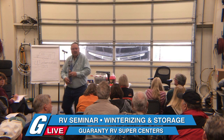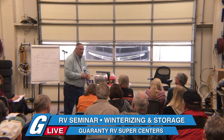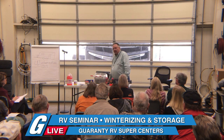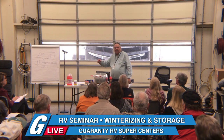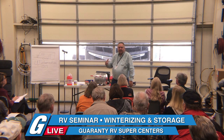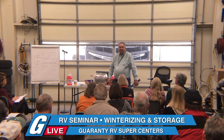Yes? You said when you flush out your hot water tank or drain it out, you never get all of it out of the bottom, but that doesn't matter, right? The gentleman's question is, when you are draining the water heater and taking the plug out, you have a residual amount down in the bottom. When you blast it out with that thing on the floor, you get most of it out. There may be a cup or two, but you leave the plug out and it'll evaporate eventually. What you're trying to do is just get all of the particulate out and all that slime out. Once that's done, the rest of it will just evaporate.